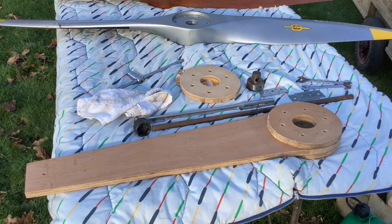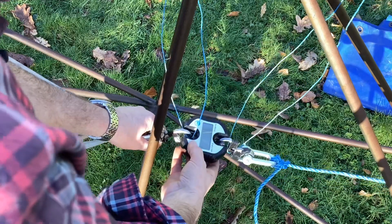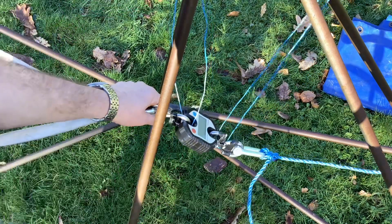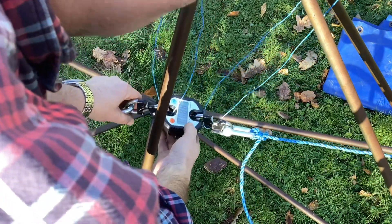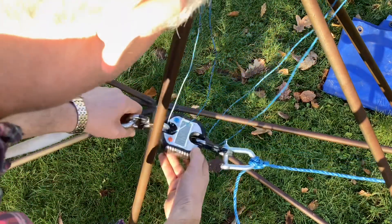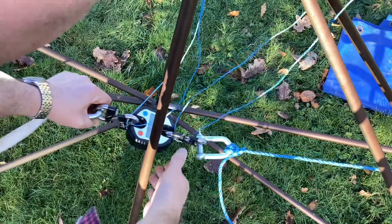Quite a lot to do. We'll just look at the static thrust measuring setup now. This is an electronic spring balance — best quality Chinese. I used it when I made the tie-down video. The tie-downs are actually in the ground here as safeties in case this whole thing breaks away. I'll be able to turn it on and the whole airplane can slide forward. We're going to measure the static thrust, and I reckon it's going to be around 200 pounds of thrust.